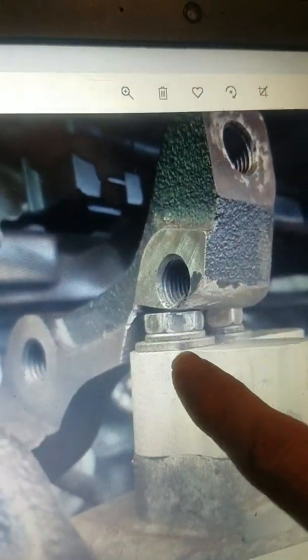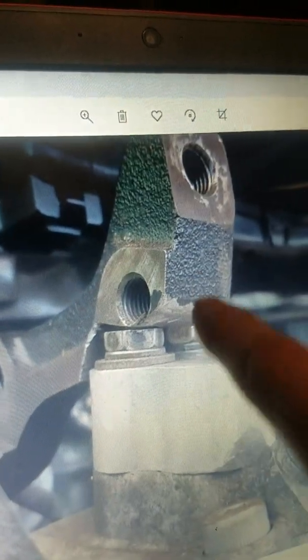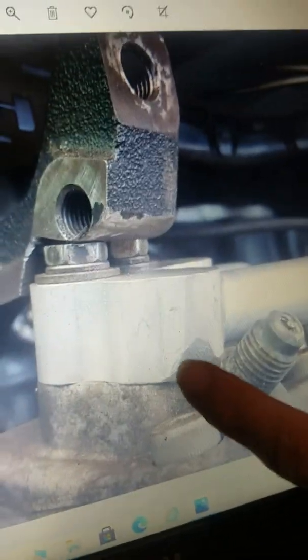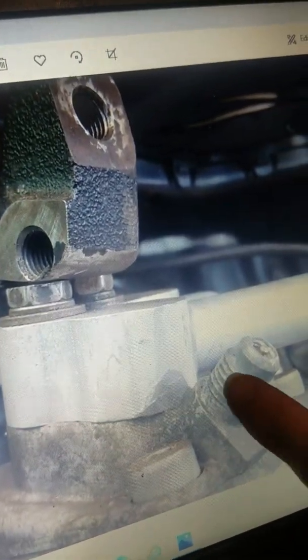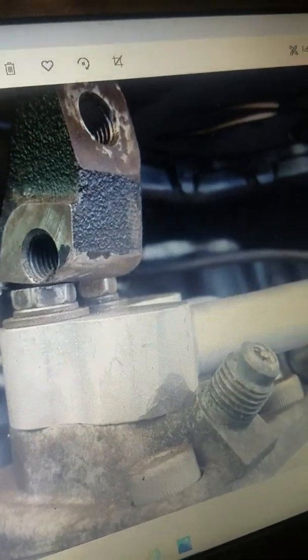This is an example of how you should grind the power steering bracket right here. See, there's just a little bit of space. To me, I really don't want the engine vibrating on the top of this. I want them to be separate so that vibration damage doesn't occur. And you can see here closely how I had to grind off a little bit of this so that it would meet that angle for the HVAC port, to put that new fitting on there for the suction side to add or remove gas. Here's another really close up right there.